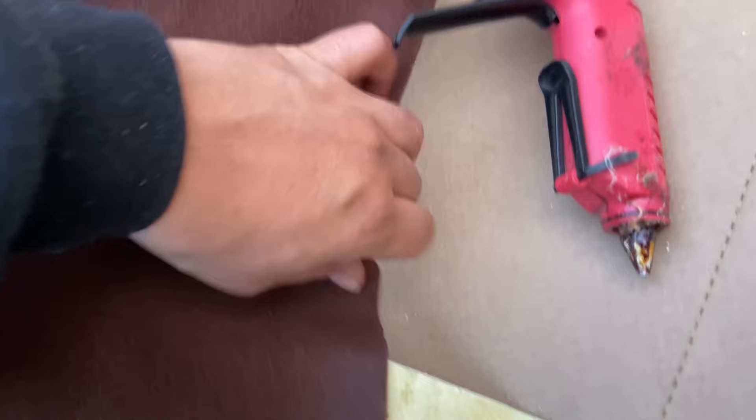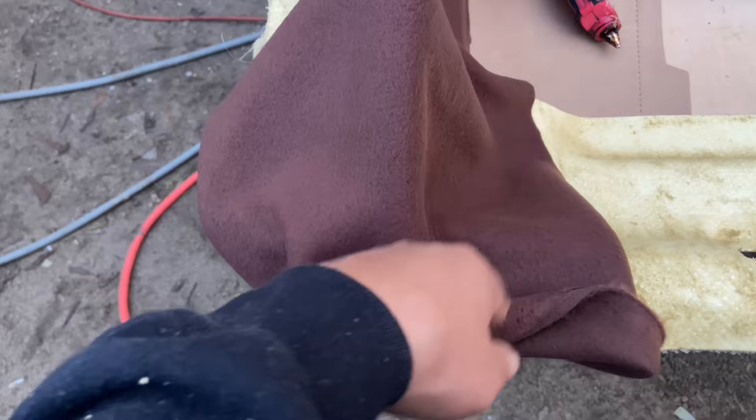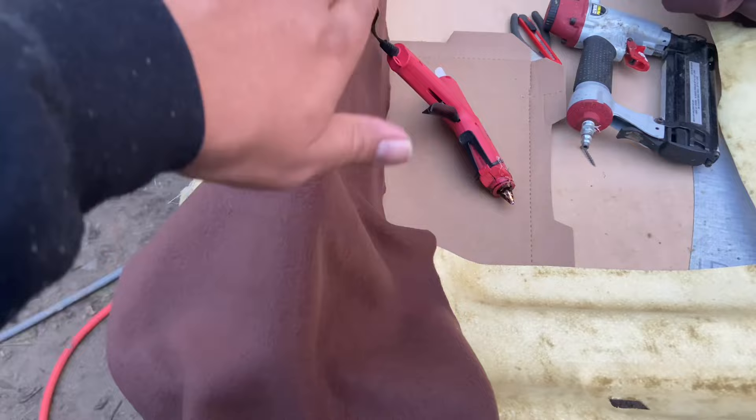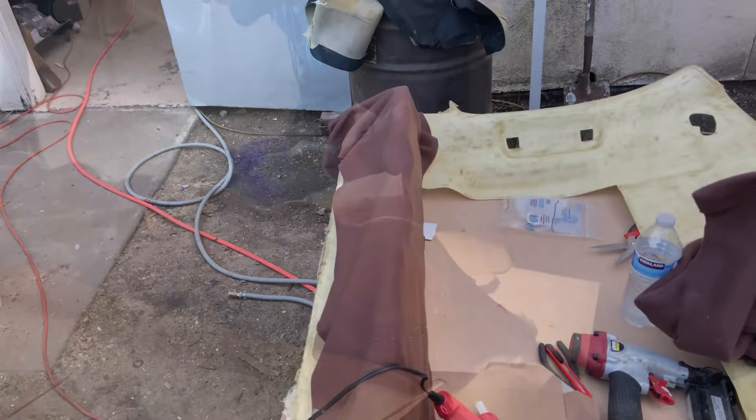I'm gluing it in place. I'm going to set my boundary line here at the edge of the cut for the sunroof, and then I'm going to pull it towards the rear. Same thing for the sides - stretch it out. The more open out you have it the easier it is to blend. You don't want lines - once you do your headliner you don't want a hard line of where your panel is, so you'll want to blend it. Here is Angel already putting the fiberglass.